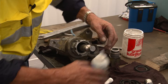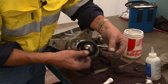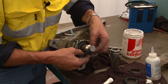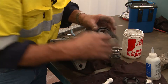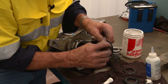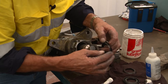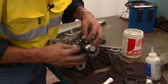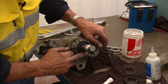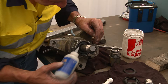Once installed, we'll put throat seal oil in there to lubricate those packings. In the kit come three different types of dust seals. The smaller one is too small. The correct one is a chevron type seal that pushes into a ring land — you push it in and hear it click into place. It's just a dust cap, and you can see the two cutouts there.